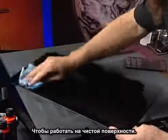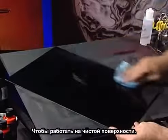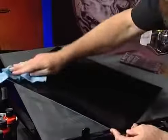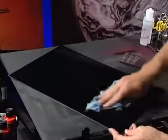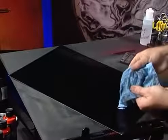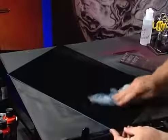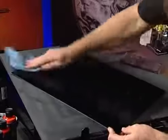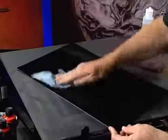We're just going to wipe it on here and wipe it off. This doesn't have clear coat on it, so we're going to pull a little bit of black off with it. I like to have it all sealed up with clear, preferably. But once we get this wiped off, we'll hit it with the same process with the mineral spirits as well. This will take off some of the chemicals from the wax and grease remover. We're really striving to get the cleanest surface possible to start with.